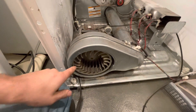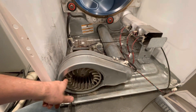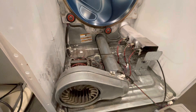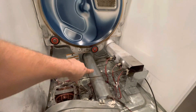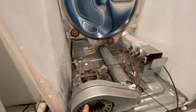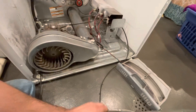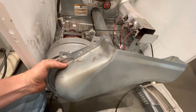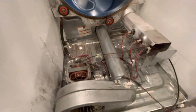The other shaft of this motor sticks out here to the blower. So this is where all the draft comes from — it's this blower moving, drawing air through the dryer and on the exterior side forcing it out. The tube going out there is the exhaust, and this here is the intake. On this side, you have this housing that sits right here, and your lint trap actually drops right in there. This is right where the door would be, so that's where your air is coming into the blower from.